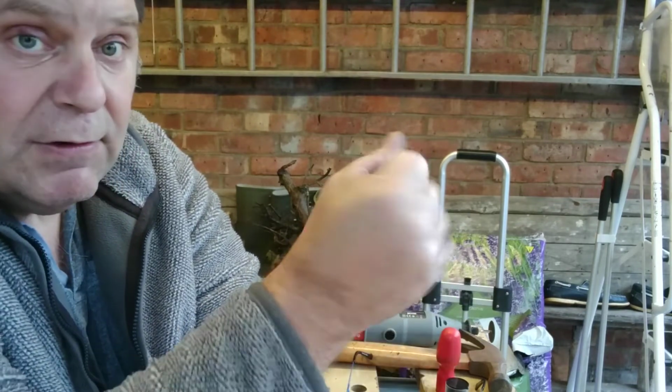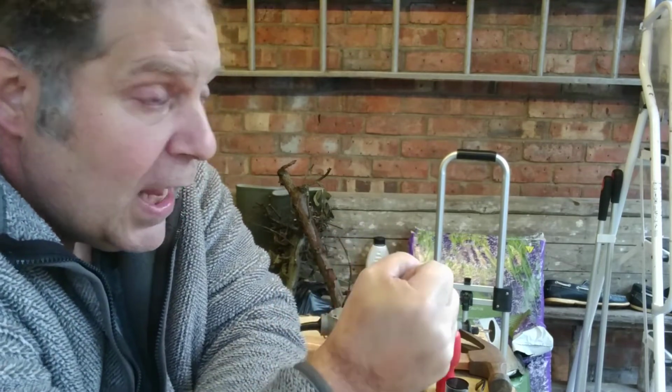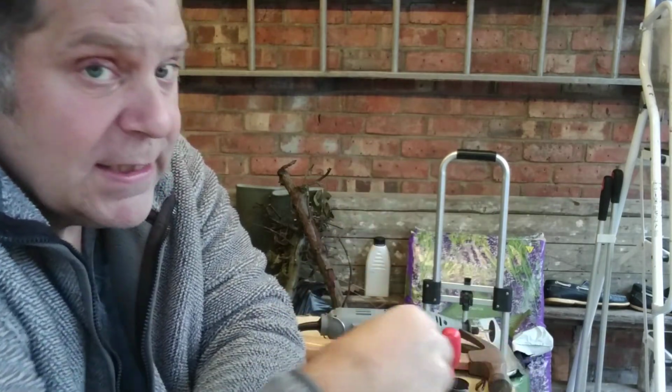And the screw was a reverse thread, so I screwed it in anti-clockwise. So if you're lucky enough to have one undo, make sure the screw undoes. You're doing it up. What you think is up, it's actually undoing it. The chuck threads normal way, so anti-clockwise.